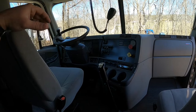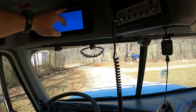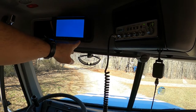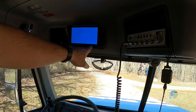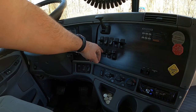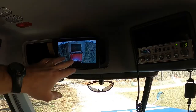If you decide to go this route, you'll have to do a little work on that — I wish I had filmed it but I wasn't doing much YouTube at the time. I've got a backup camera right here, tied into the power that's up here for a CB radio. It only works when the keys are on or in accessory. The camera on the camper gets its power from the parking lights, so you have to at least turn your parking lights on to get signal — that way I can monitor the Bronco and keep an eye on my hitch.